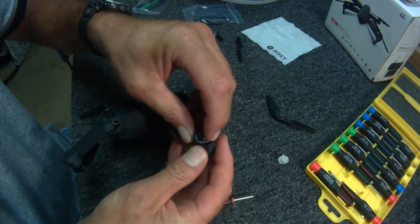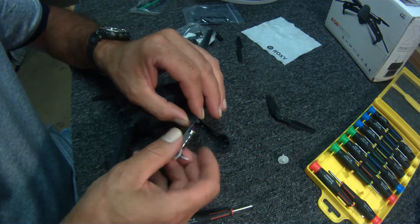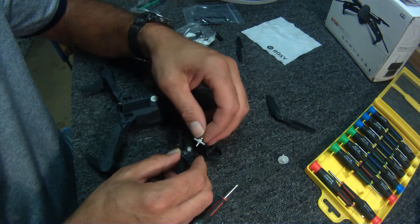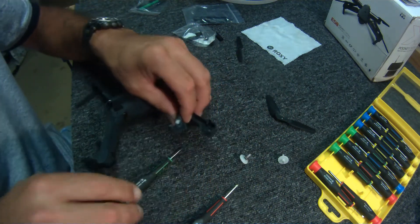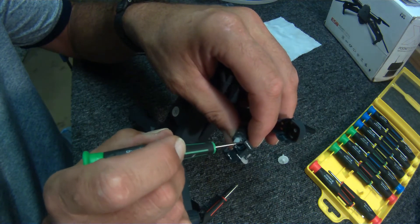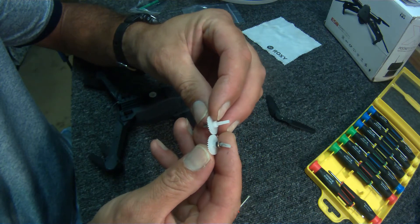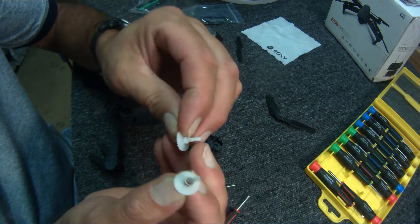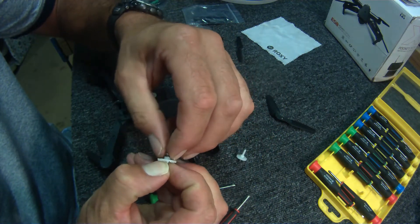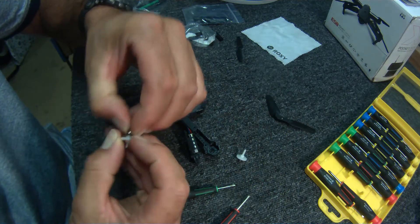Just give that shaft a push to dislodge it. If you lift up this bottom part, you can actually just pull the motor and gear segment out without any disruption to the rest of the unit. That simply comes straight off. Have a quick inspect of this gear in here, make sure the one on the motor is still pretty good - that's intact, which is good. Just a little bit of grease around there. Old versus new - you can see a definite issue with that one. Exactly the same part. Now we're going to have to remove this steel spacer here - that should just slide straight off.